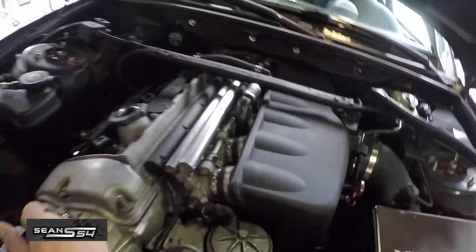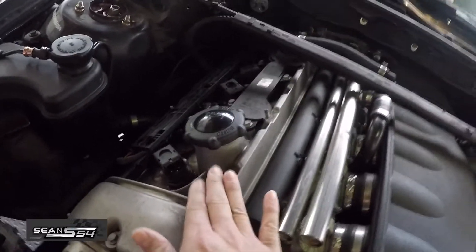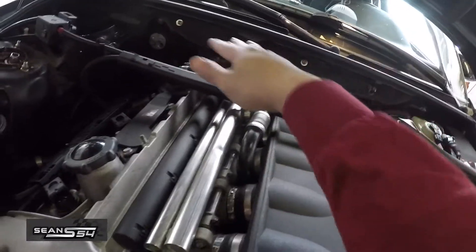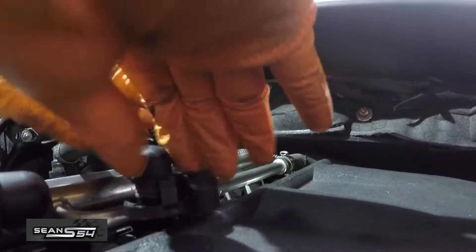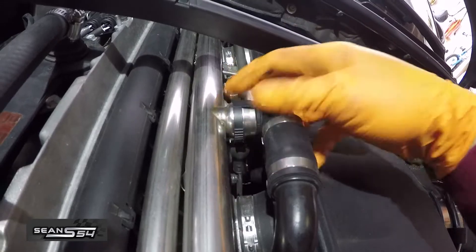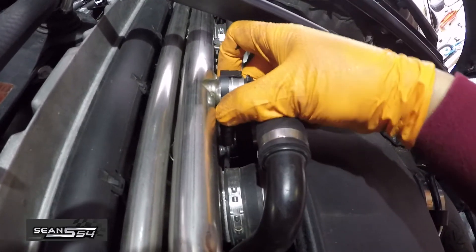Because this is a track car, I don't run an engine cosmetic cover here, but this is irrelevant. You do want to remove your cabin filter here to have more access to the fuel rails. We're gonna pop this off — you squeeze here and it'll pop off. We're gonna pop this side of the ICAV off as well.